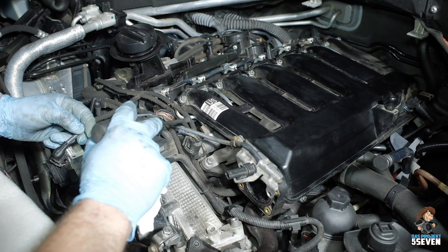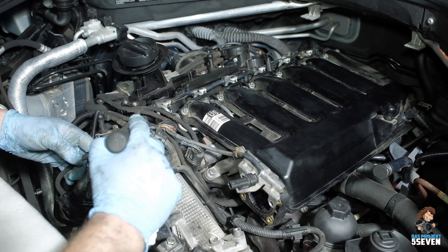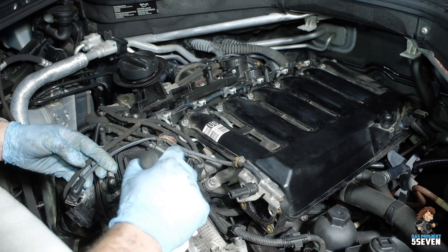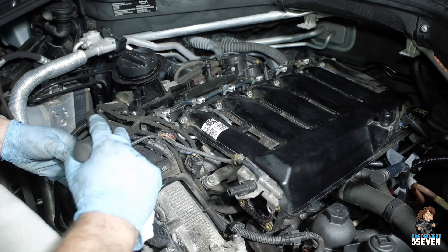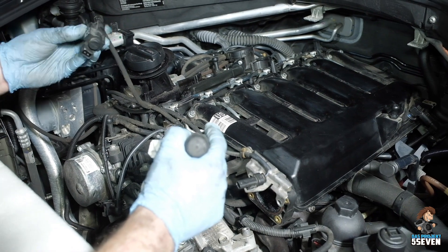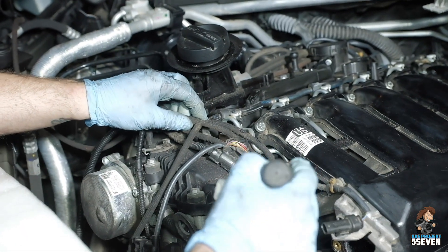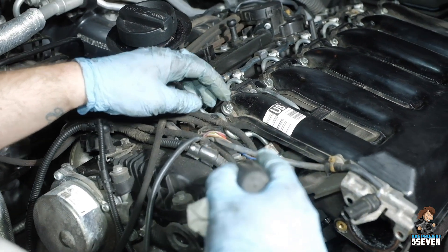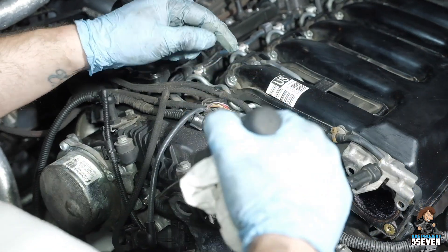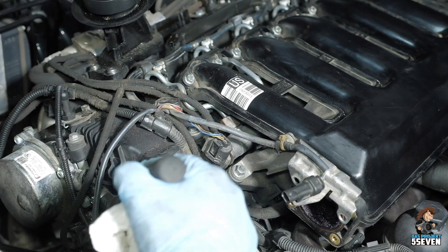This is an X5 - it's semi-stock, has a DPF, low-pressure EGR, and high-pressure EGR. What we're going to do is the turbo control side of vacuum lines, but we're not going to do the low-pressure EGR, the motor mount side, or anything under the car today. We'll cover that in part two. The EGR cooler has been removed, and there is the electric switchover valve for the EGR cooler - it feeds off one of the lines. We're probably going to cut it here and then splice it, so when we do part two we'll take from this splice and do the other side.